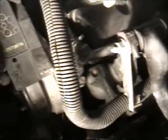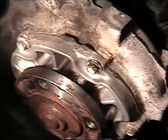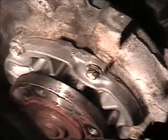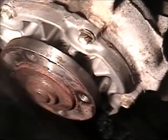You also have to remove this cover here — there's a little nut right in the middle underneath it. You remove that, and that allows you to access the water pump. After removing the pulley you can access the water pump, which is held on by these bolts — I think there are five of them. These require an 8mm socket. Just remove those and you may have to tap the water pump a little bit, and it should come right off.